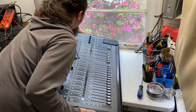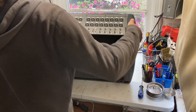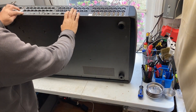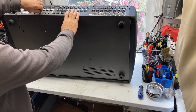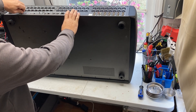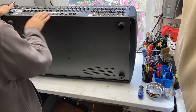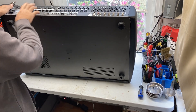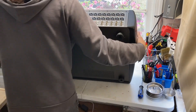Now to install the side panels again. Just need to get the one on the bottom now. I try not to flip it over on the back unless I take the card out, because it has these knobs on the expansion slot and I don't like to put any pressure on those. So if you do have to put it on the back, it might be a good idea to take the expansion card out before you do that. I'd like to go over towards the front.